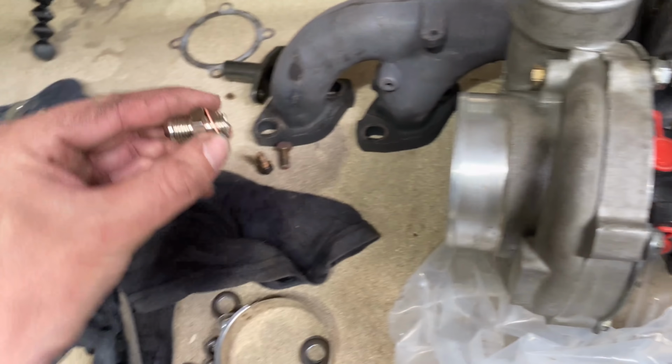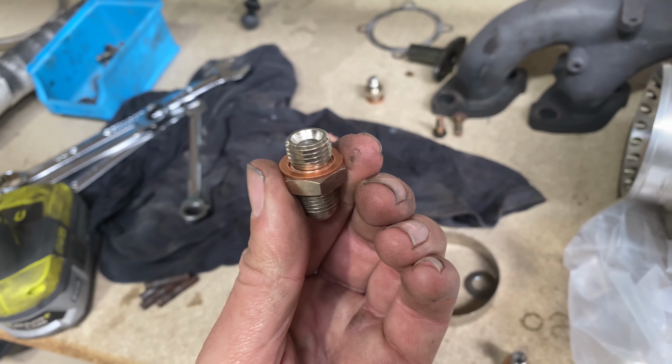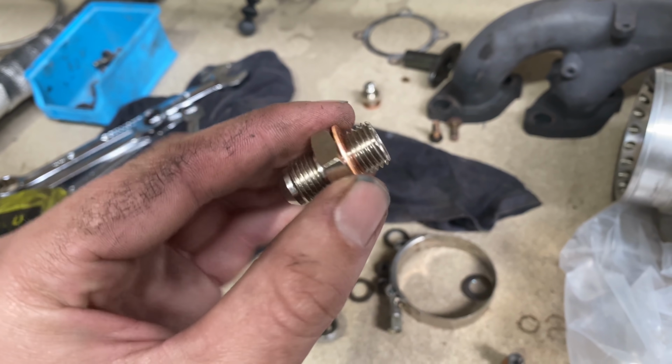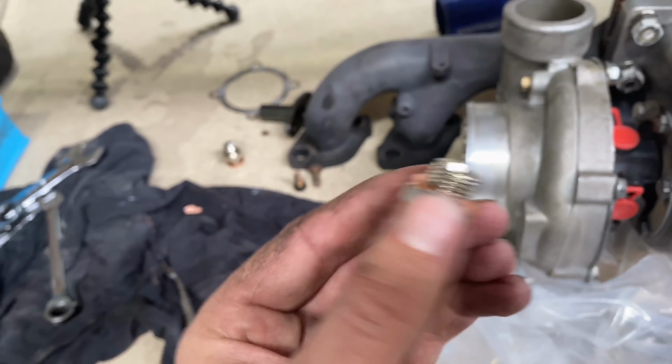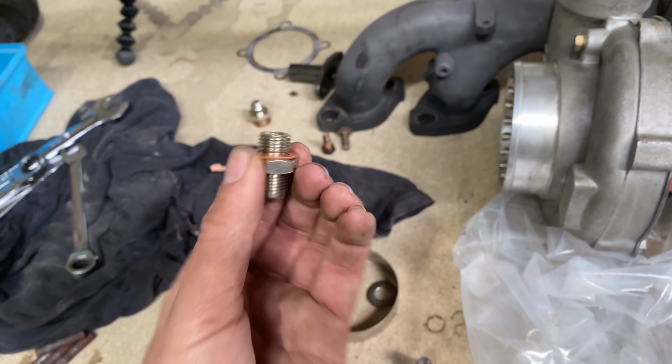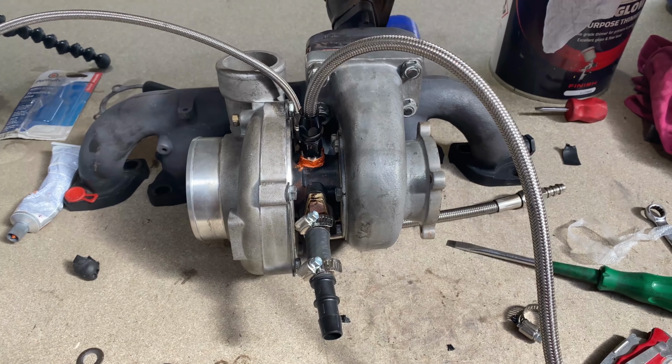And yeah, apart from that, water fittings, which are different to the other turbo because they're smaller, but luckily the Kinugawa kit has them in it. Same thing, I'm going to copper gasket RTV those in because I really just don't have time for water leaks. So that's the plan there, same as last time. Seemed to be a pretty good setup that worked. It didn't leak at all.